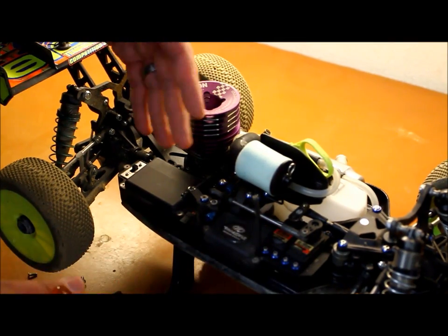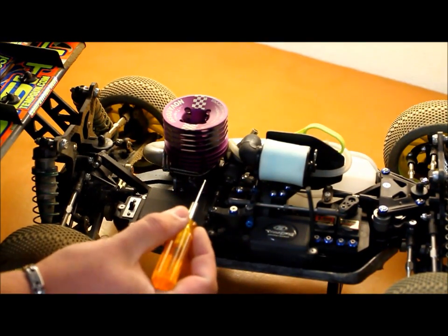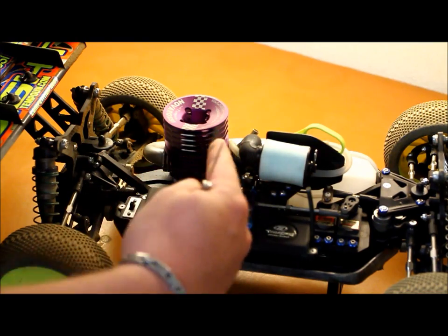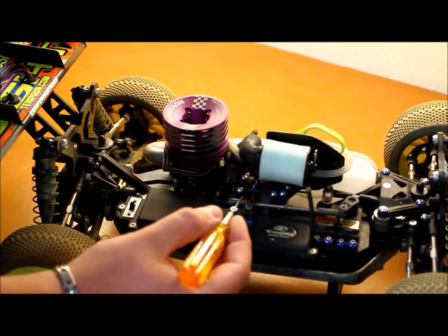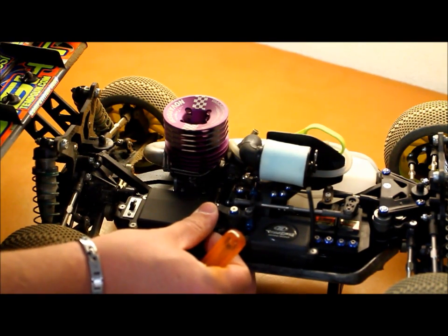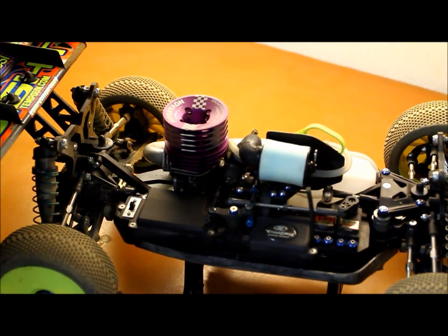Now what that'll do is it starts at a slight angle, but when you go to full throttle, it will pull the carburetor really, really straight, where if you start with the horn straight, it starts to wrap or bend around, and then you may also run into a problem with having to pull the carburetor so far that the ball cup will actually rub on the linkage a little bit. So starting with it at a slight angle, when you pull the carb to full throttle, there's plenty of clearance, and that's pretty much how it works.